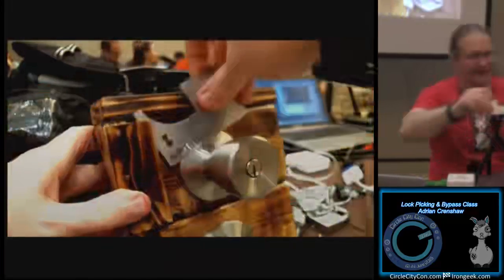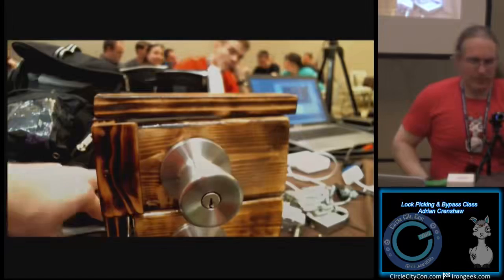That little button is depressed enough to where I can't reach in and get into it. And I also have some plating there so I can't directly get to the latch. However, even if that plating was there, if it was badly hung, I could still potentially get to it. They make these little mica sheets. In the Chinese companies you order from, they call them nanomet sheets or something like that. Anyway, they're very tough pieces of plastic, very flexible, that you can go in around things like molding and still be able to open it. But you can get into a lot of doors that way.